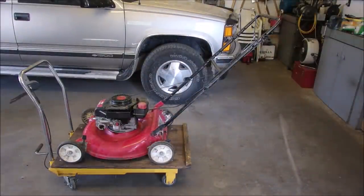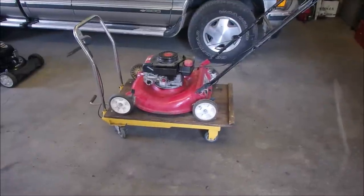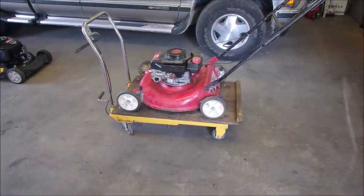Do you realize what we did there today, guys? It came in — the carburetor was toast, it wouldn't test to three pounds. So I changed out a carburetor as close as I could find with the same intake manifold. Gas line was corroded. The blade is still upside down, by the way. Cleaned the plug. Quite a bit of work redoing that carburetor — I had to look to the third carburetor. One was the one that was on it, two was the one that was leaky, and three was this one — and it holds five pounds.